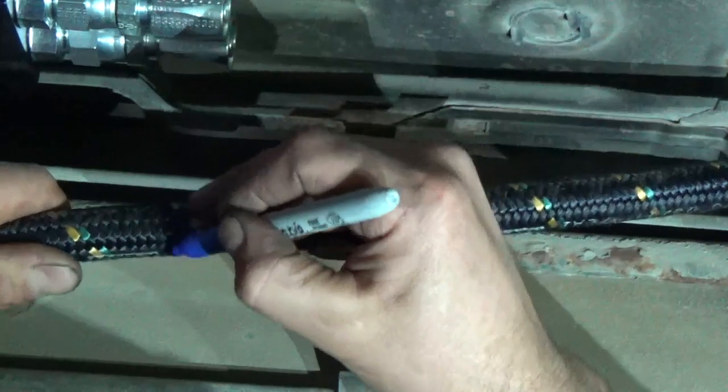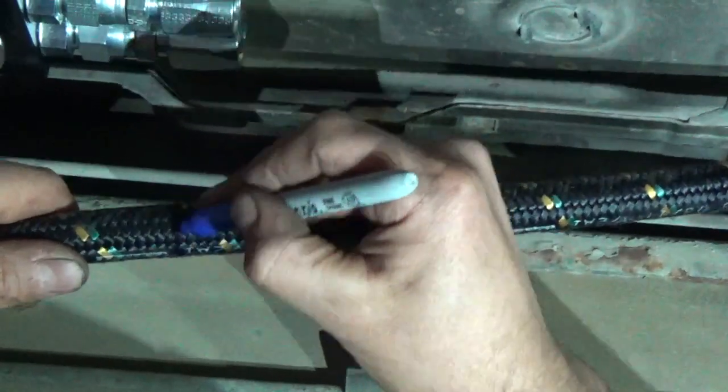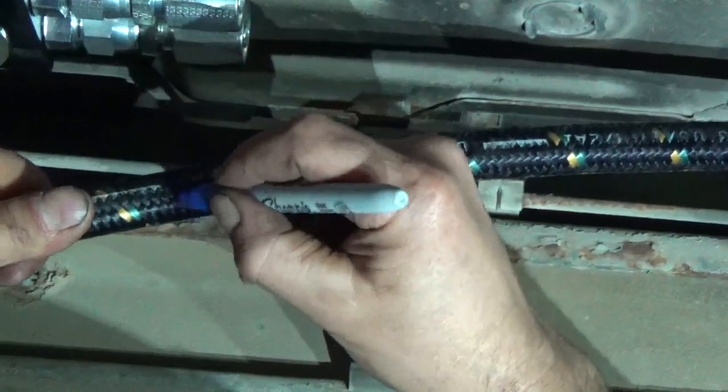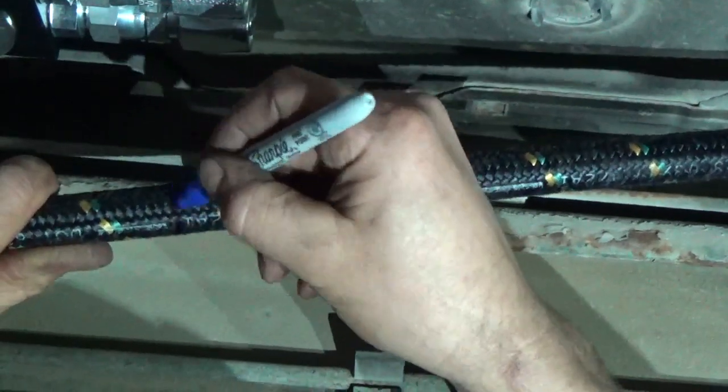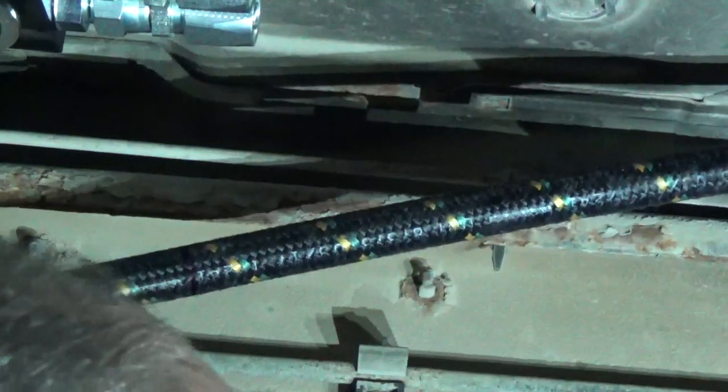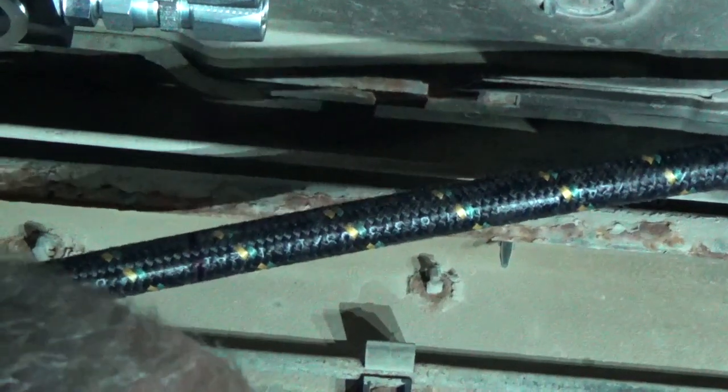And this hose does not have any wire braids in it. So you can use a hose slicer to cut it. I can show you that here in a minute. That gives me the markings on this one. So we'll take that back out. We'll cut it and assemble it on the vise. Then we'll measure the same way on the other one.